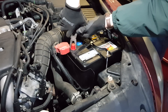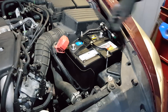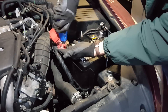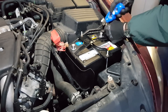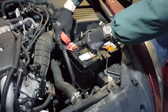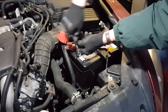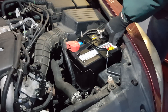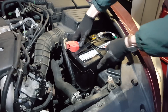Get off these protective caps. Now the new posts are nice and clean but I'm going to clean the terminals with my battery brush. Now we start with the positive battery terminal so we don't have a risk of shorting out the system. And then the ground. And we're all done.